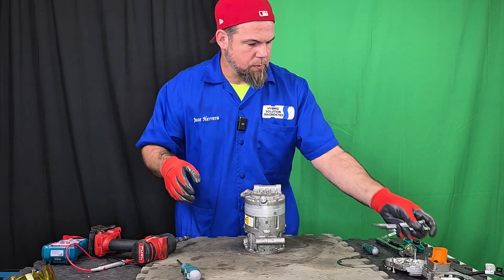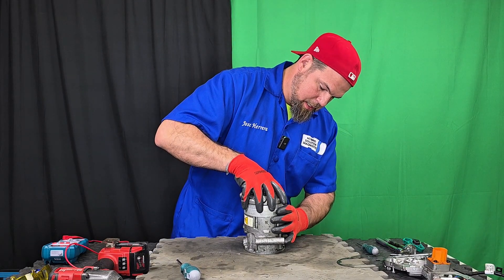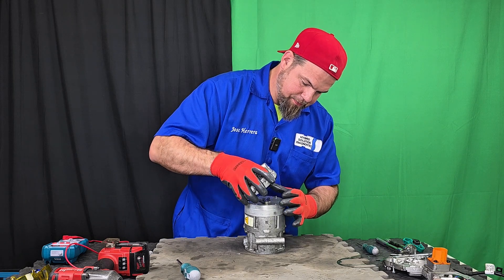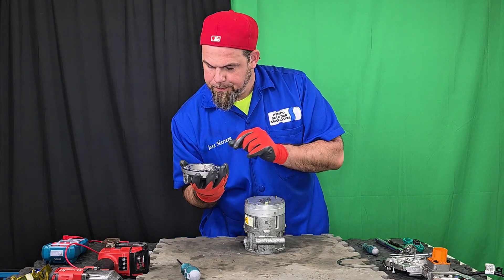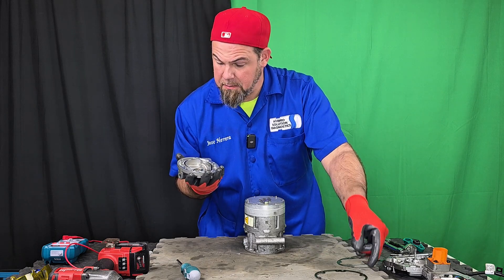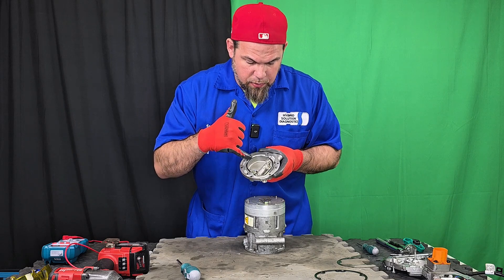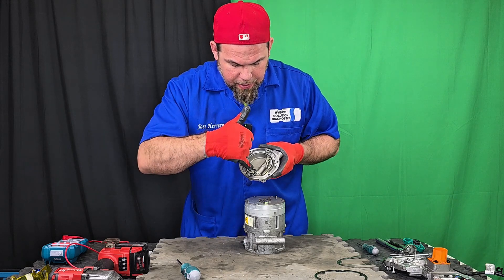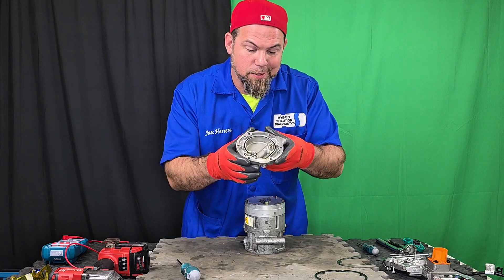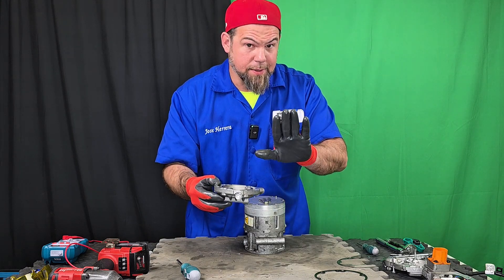The scroll is the first component I'm going to take out. Let me take out the back cover. It has a gasket here in impeccable condition. What I'm looking for is if there is any metal debris in the outlet net — and it looks absolutely impeccable, which is a good sign.